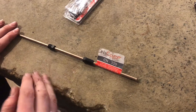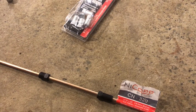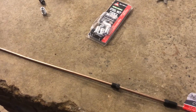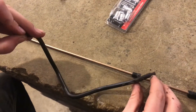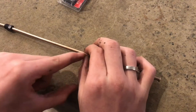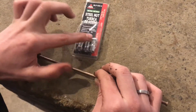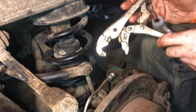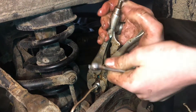When we bought this nickel copper line at the local auto parts store, they don't sell it with the right fittings. We went to two auto parts stores and they don't have the right fittings, so we have to build the brake line. We take the old brake line from the car, place it alongside the new line to get the right size, go about two inches extra to give some slack, then cut it there. We remove the old fittings and put on these new fittings from the auto parts store. Those will screw into the pipe we need. We clamp it using vice grips that grab in three points to evenly distribute the pressure, clipping on just like that.